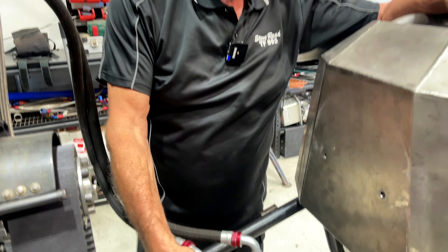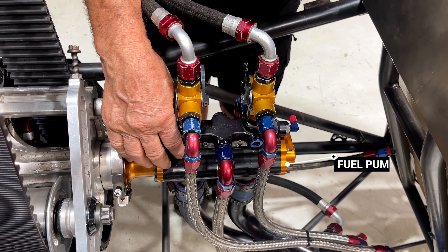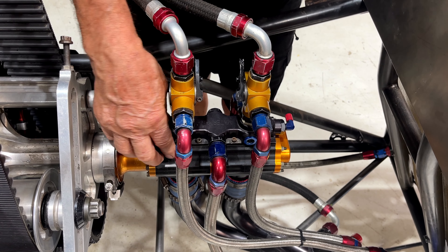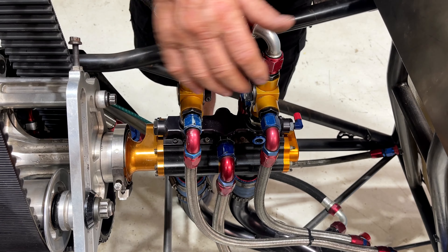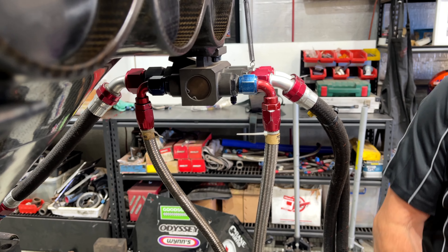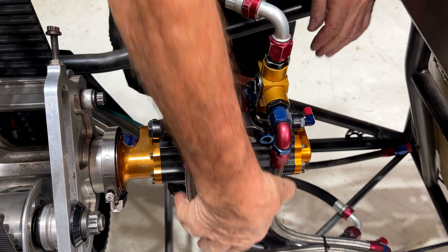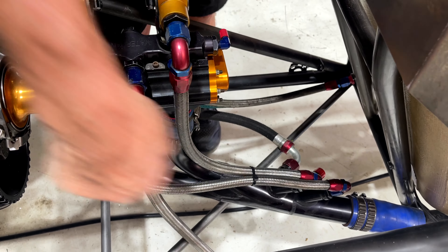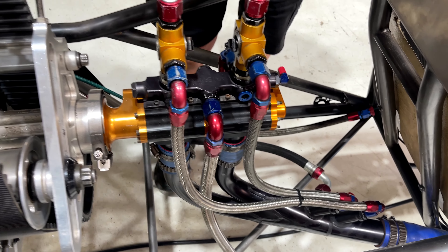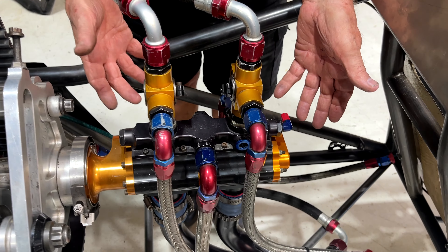What we're looking at here is our fuel pump, which is driven straight off the front of the camshaft. This is roughly a 96-gallon US pump — about 365 litres for those who understand litres. On here, this is our main delivery line which goes up to our metering block. When we shut the fuel off after a run, it returns back down into this manifold here, which basically just circulates the fuel around. Off of here we've also got a fitting that gives us pressure, so we know what pressures we're running.